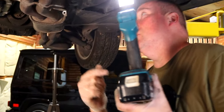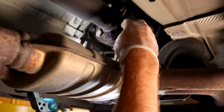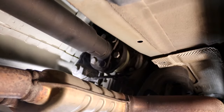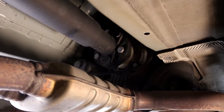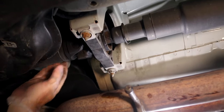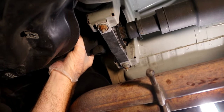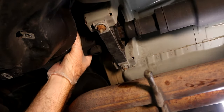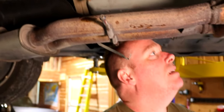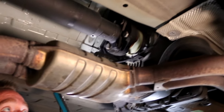Let's look on this other side and show you what's going on. Here's the Guibo bushing — it actually looks really good. What the problem is going to be — come around from this way — it's going to be this guy here, that's a no-go. It's very rare that this goes bad when the Guibo is still good. We might have got lucky, so I might not have to replace this already.